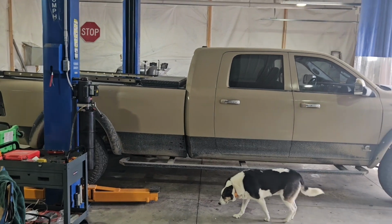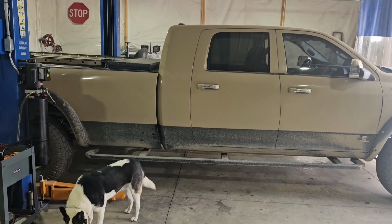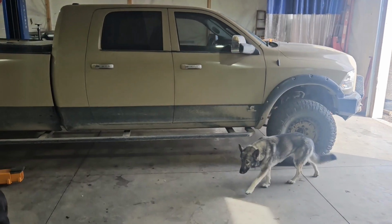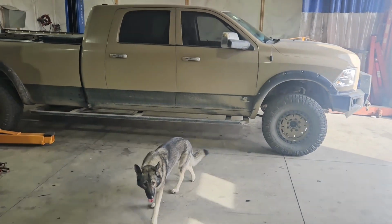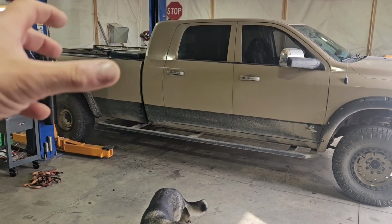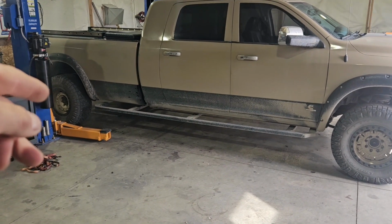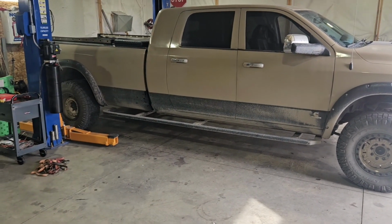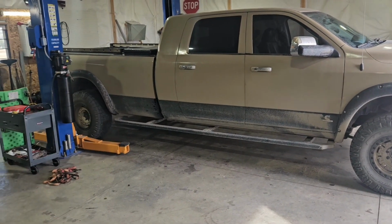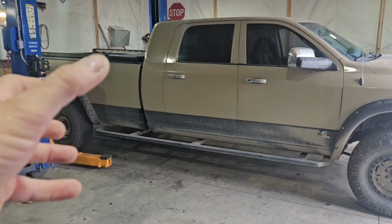Well, the fuel gauge quit working in this truck a while ago, because this has an aftermarket fuel pump in it for the bigger fuel injectors and the turbo and things that are on it. Because the aftermarket fuel pump hangs down underneath, the way it feeds into the fuel tank, you take the factory fuel pump out and put it all back in, but the factory sending unit kind of stays in there. The rough roads and gravel roads and driving, the fuel sending unit actually popped sideways in the tank